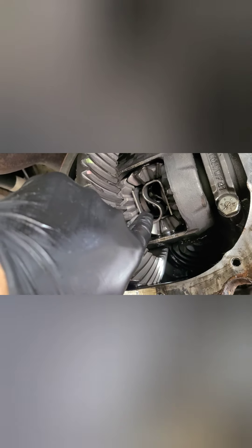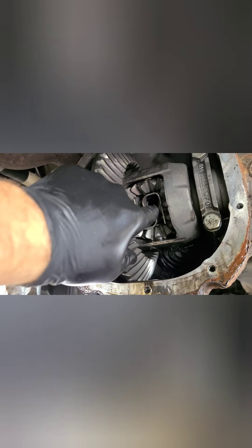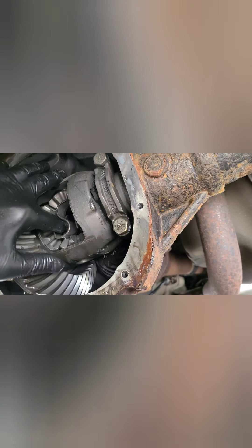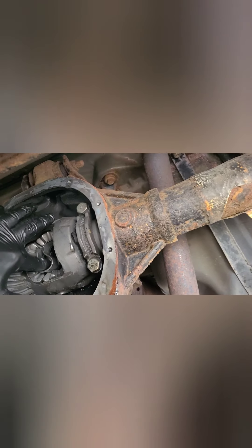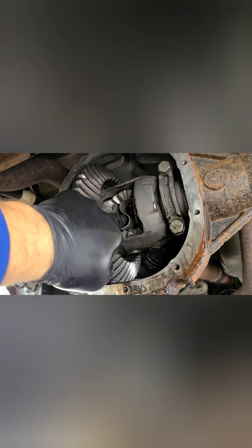The first thing you have to do is see inside - that's your axle. I'm going to push this in with my foot - that is a C-clip and those have to slide out. Those clips have to come out and then you can slide your axle back out, and then this S-spring can slide out - otherwise it'll jam up on the axle.